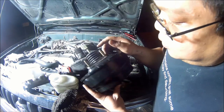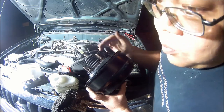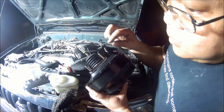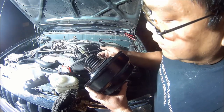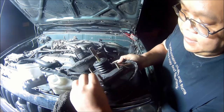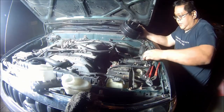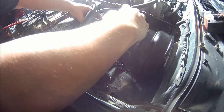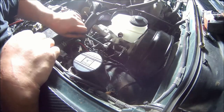The easiest thing to do is shave down the spacer. The reason I put gasket maker between there is because the cut was a little uneven — there was a slight gap — so the gasket maker keeps engine gases from getting inside and keeps it clean. This will give you just enough to thread the bolt all the way, which is more than enough. The rear brake fluid lines still line up perfectly fine.